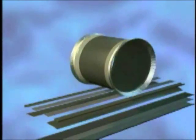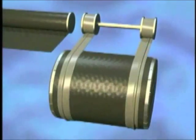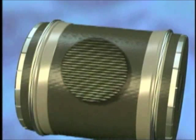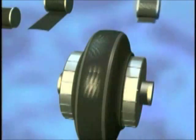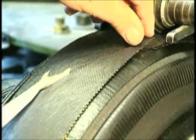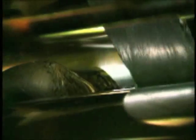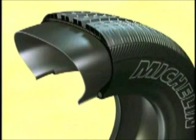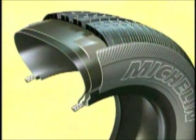To understand the different types of damages that can happen to radial tires, it is helpful to know how a radial tire is put together. The foundation for the radial tire is the construction of the specially designed bead bundles. Steel cord material is wrapped radially between each bead bundle. The steel belts are laid over the radial casing to add stability and protection against road hazards. The rubber products are an integral part of the radial tire and are added during various stages of production.